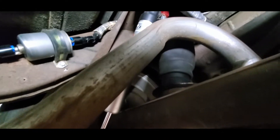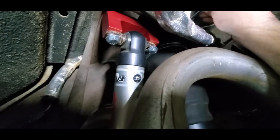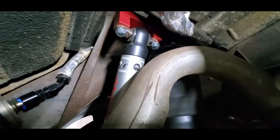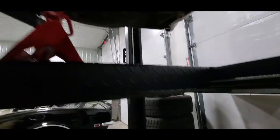It is really hard to get up in here. Getting all the washers and everything lined up because they're indexed — that's something — but I'm finally on it and finally tightening it. The ratchet wrench has to go on upside down to get down in that hole. If you're doing something similar: patience, patience, patience. At this point we now have these airbags back in. We're going to drop the body back down, get all that on, tighten all the body mounts, and then drop the car and work on that other leaking fitting before we worry about those sensors.